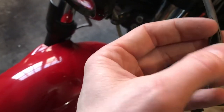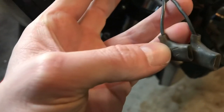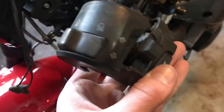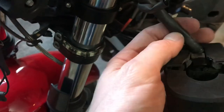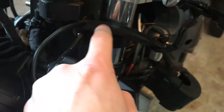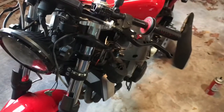What I'm doing here is I've taken an exacto knife and I'm peeling back this wiring harness so I can tell if there's a short or a break in one of these lines. I'll take one of these little boots off too and trace it all the way back to the left switch. The button doesn't work. Hopefully the problem's before I get to the switch, but if not I'll split the case and follow all those wires into the switch. If it's not there, it's a problem with the switch or the fuse.